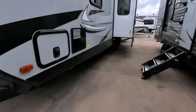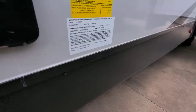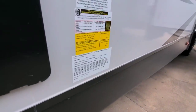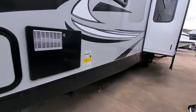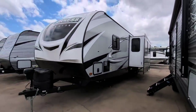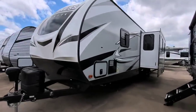Let's take a look at the numbers. This has a gross vehicle weight rating of 9,600 pounds — this thing's kind of heavy. It has a cargo capacity of 2,102 pounds. Rides on E-rated 15-inch tires, and this is definitely a travel trailer I would say is more along the three-quarter ton line as far as towability. I definitely would not put something like this behind a half-ton truck.